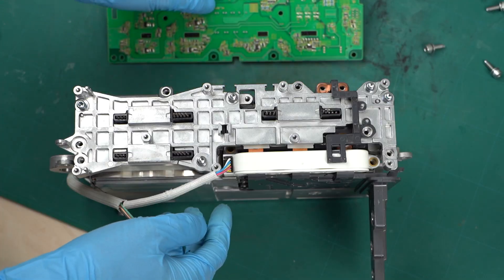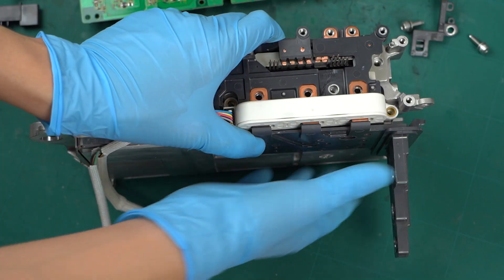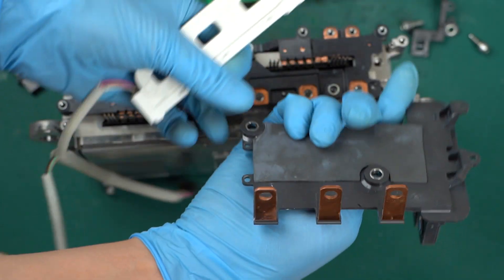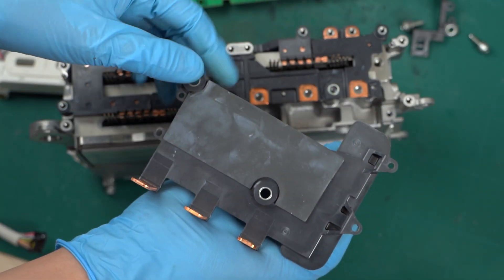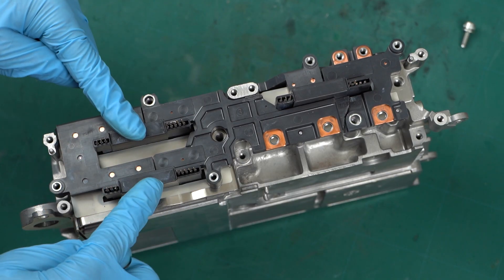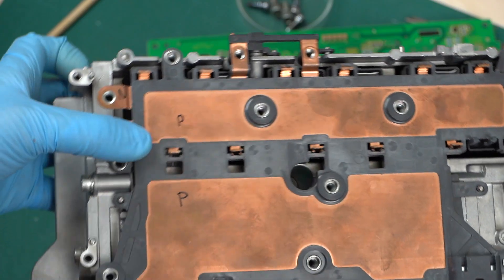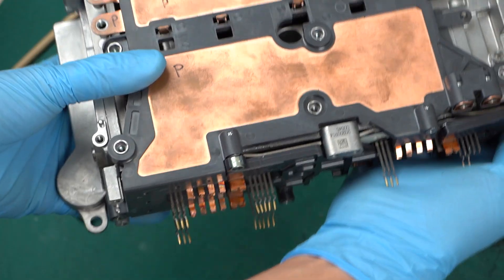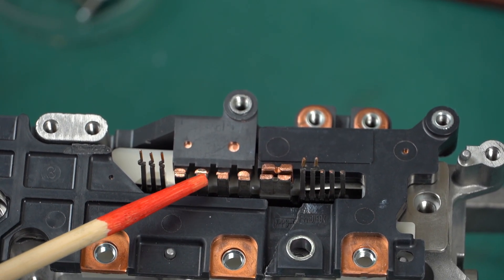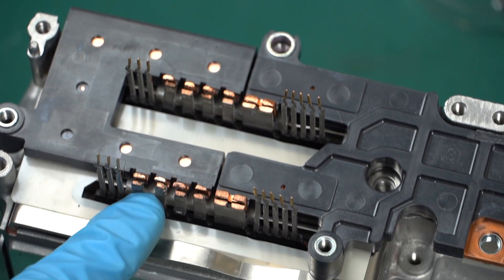Let's remove the gate driver board. You can see white current sensors here — they are sensors for the motor current, phases U, V, and W. You can detach the sensors; they come with a bus bar, and you can penetrate the sensors with the three-phase output. A thermal conductive sheet is attached to the bus bar. The sensors are made by LEM, a very famous company. Now you can see the power semiconductors — these are the three power semiconductor modules. The DC bus bar and the power semiconductors were originally brazed or welded together, but this one is cut apart for disassembly.